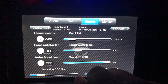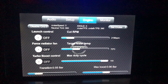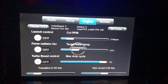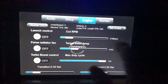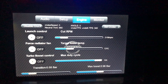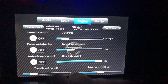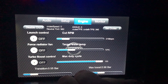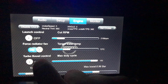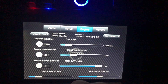There's also launch control for limiting the revs just before launch so you don't slip the tires — useful in rain. Here we have a setting for the target coolant temperature on the radiator. I don't actually use water — I use a liquid called Evans, which avoids rust and is for classic cars. And here is for forcing the radiator fan on for whatever reason — let's enable it for a second so you can hear it, and now let's disable it.